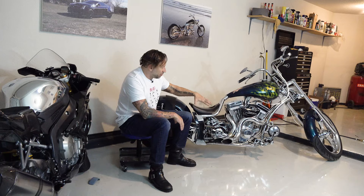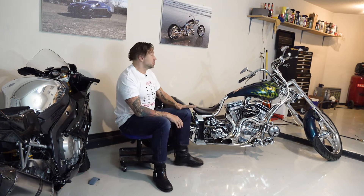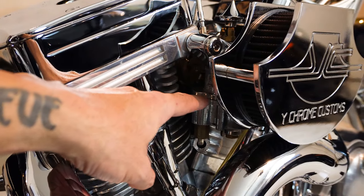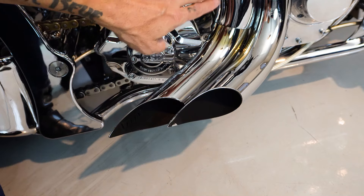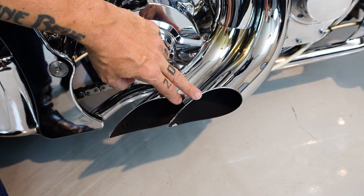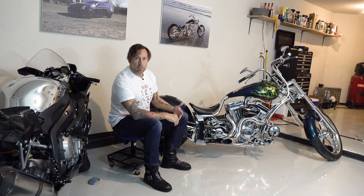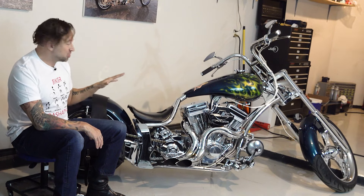They look awesome and they sound incredible. The pipes were super loud when I first got it started, and it was a little bit hard getting it set up as far as tuning goes. I ended up having a triple X conversion done to the carburetor to get that dialed in a little bit better, and then I put flexible baffles in each of the exhaust pipes just to give it a little bit of back pressure. A lot of these V-twin engines you almost need some back pressure to keep it idling at the low end and allow you to really tune it through the whole RPM range. Once I got it dialed in, this thing had incredible power and kick — I was super happy with it.